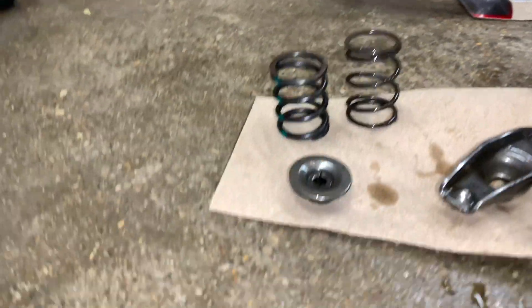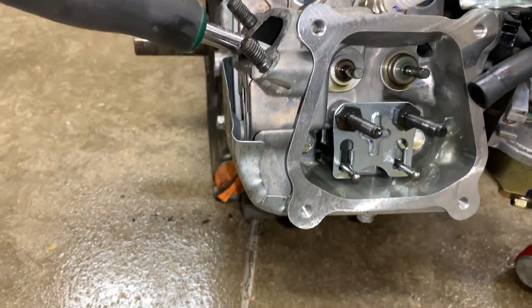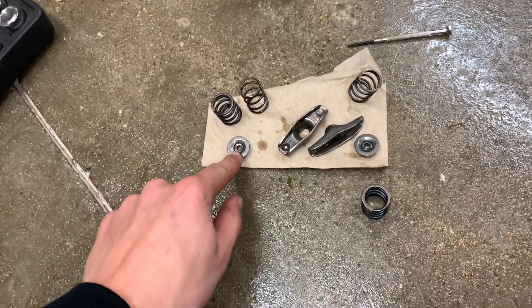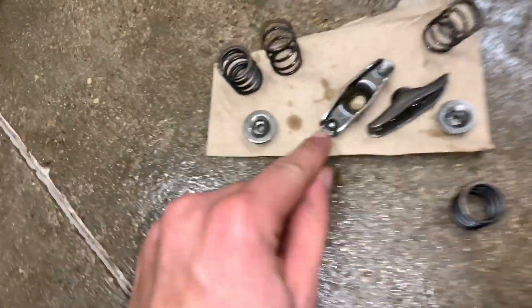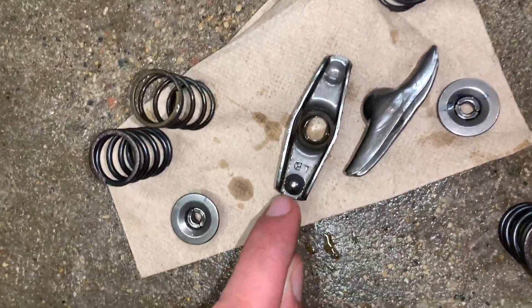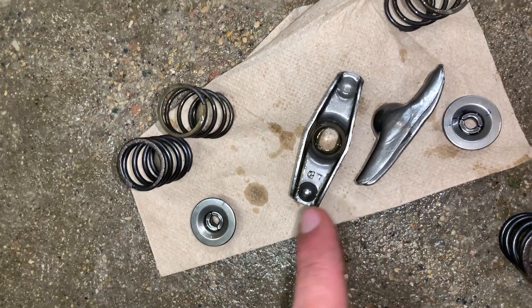Push it down, take your caps off, move it to the side — it's off. Use a magnet. New springs — nice, look no different — but got that all removed. Didn't drop a lash cap down there, thank goodness. Now installing them: put this back on, lash caps set it on, get your rockers back on. Make sure this one's on the bottom — you can clearly tell it's different by the shading or the reflection of the light. This is the bottom.